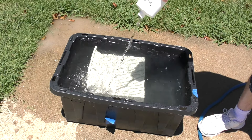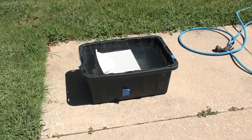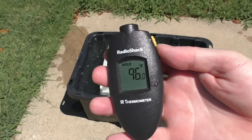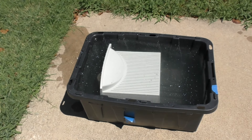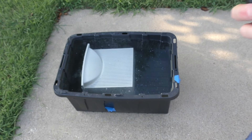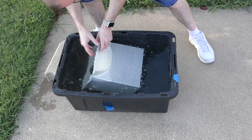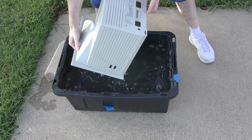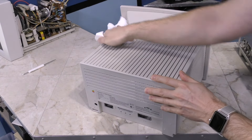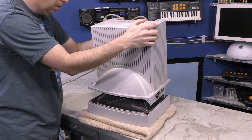I'll add an additional bottle of peroxide. I let this sit out for the rest of the day and then the entire rest of the next day. I came out every few hours to try to eliminate bubbles and kept an eye on the temperature. It stayed pretty warm, but never got quite as hot as it did with less water — by the end of the second day, temperature only reached 101 degrees. I thought about getting my sous vide cooker out, but I could tell the color was improving despite the lower temperatures, so I just left it alone. And so here we are, a day and a half later. Drying it off, I can already tell this looks so much better. I'll go ahead and reassemble it and see if it matches the front bezel.